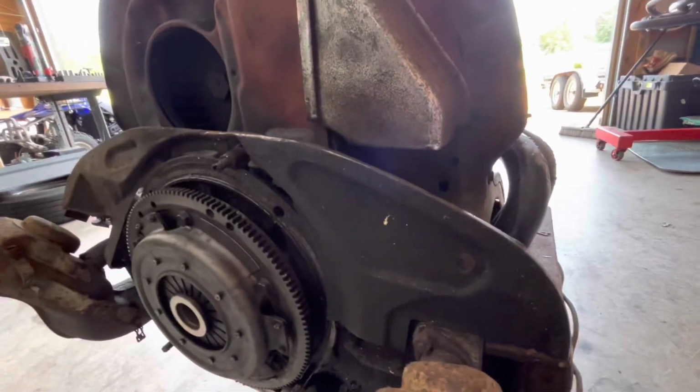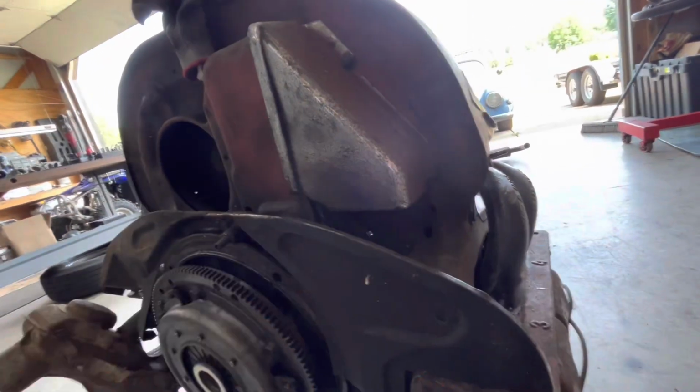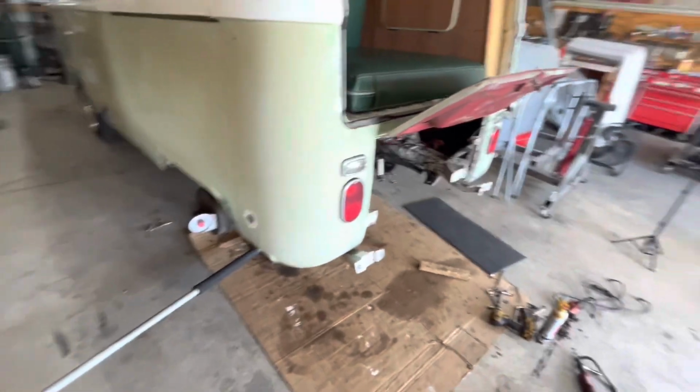So you know, for next time, when you look at this, you need to have that piece, because you want to blow that hot air that comes from the oil cooler out of the engine, not keep it in the engine, because you're going to feel that it's way overheated. So, all right, let's move on.